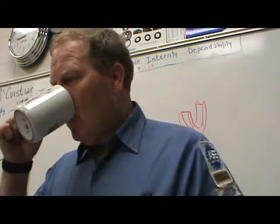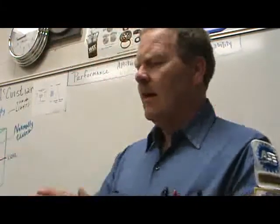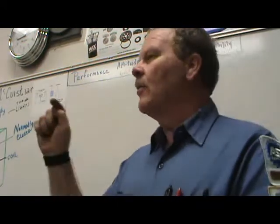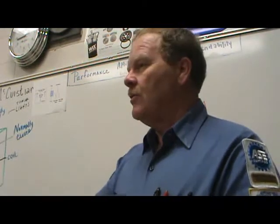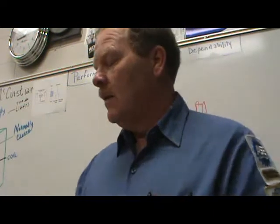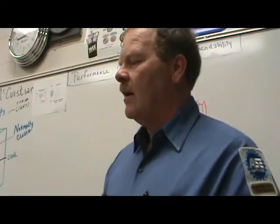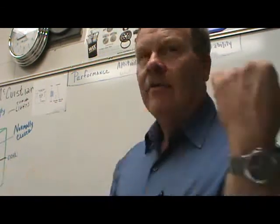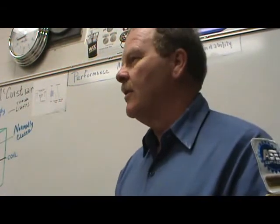Is it at the bottom of the stroke? It's at the top of the travel. It's where the rings stop every time the piston comes up. It will actually make a ridge right at the very top. And we used to, whenever we pulled a head off one, back in the 70s when I first started, the first thing we felt was that ring ridge. And if it was bad enough, we'd have to use a ridge reamer. I've got a ridge reamer in my office in there, but we haven't had to use it a single time.